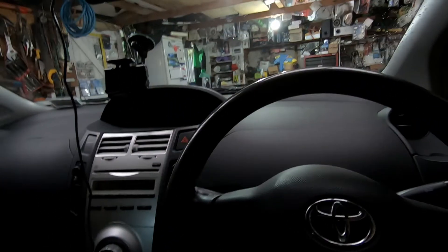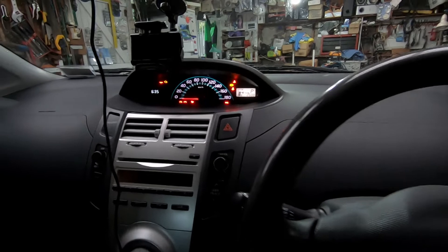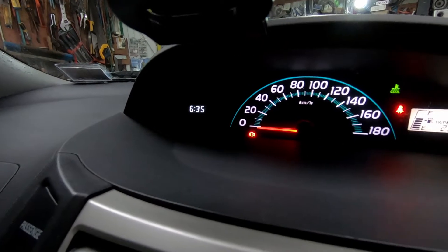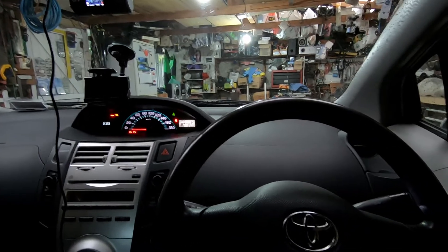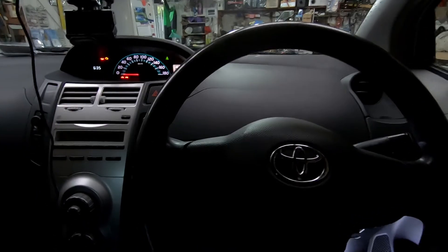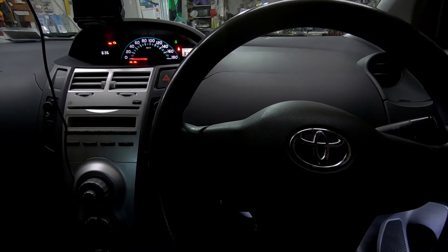On this particular vehicle, this is an intermittent fault, so it only really acts up when the engine's warm. There's no check engine light or anything. Normally if you have a bad misfire, that check engine light will stay illuminated indicating a fault, and you can scan for codes. It might show up with a misfire code, or it might not, because really only under light loads do you feel a bad misfire — when it's up in the RPM range it goes away.